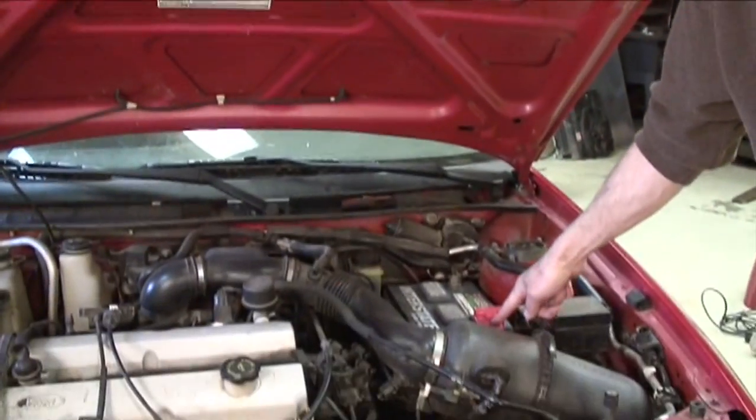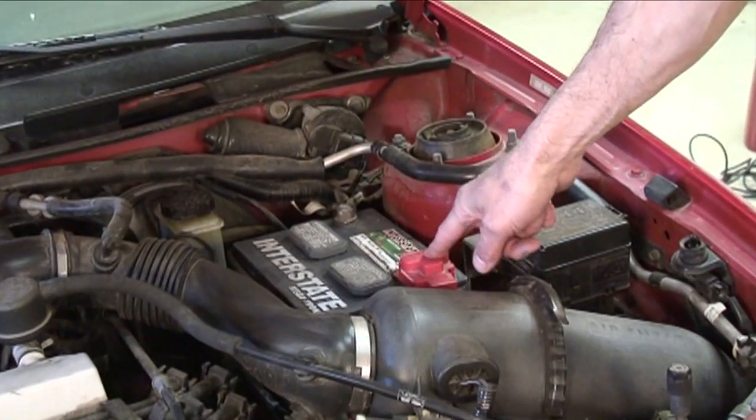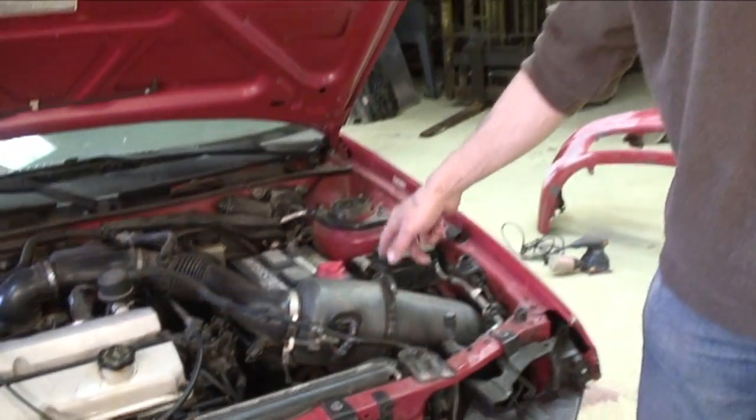One thing I have a lot of fun with is anytime I get a salvage vehicle — usually they've sat for at least six months — the battery's always dead. I have a special desulfation battery charger. When car batteries sit for a while, especially if there's a clock running in the car, the battery will run down and sulfate up. I've had very good success with these cars that have sat a long time by desulfating the battery. This car was hard to start because the battery was so flat it was pulling all the juice out. We took the battery out, desulfated it for maybe a day and a half, put a charge on it, and it's been fine — it starts up every time.